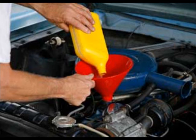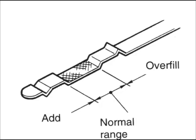Once you have added the recommended amount by the manufacturer, make sure that everything is securely fastened to the engine, including the dipstick, the drain plug, and the oil filter, and proceed to turn your car on for about 10 seconds. It is recommended to give your car a little bit of gas, not over revving it, but just accelerating the car a little bit. Once you have done this, turn your car off and check under your car for any possible leaks.